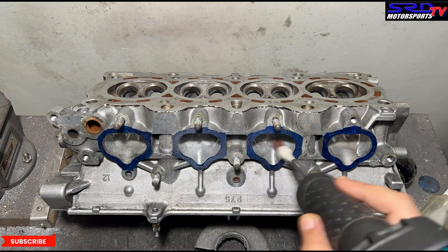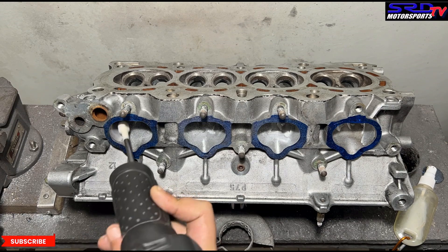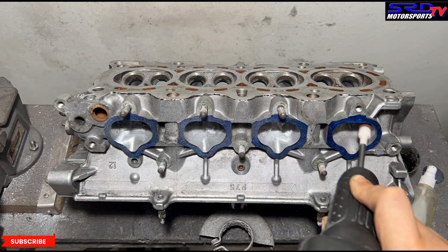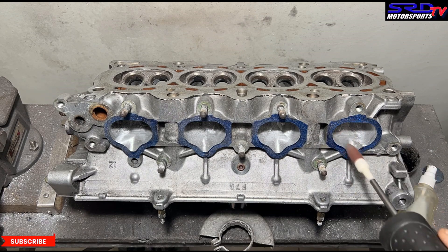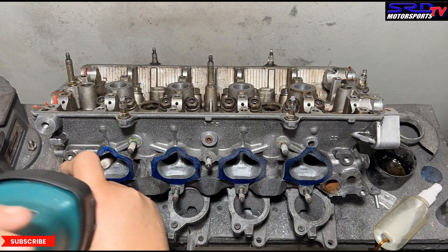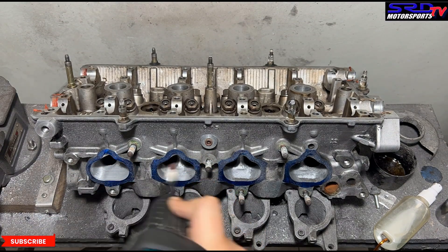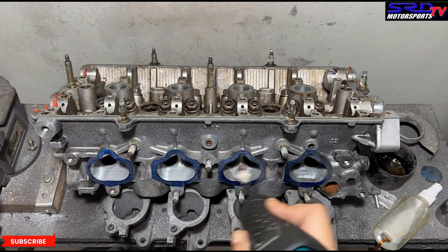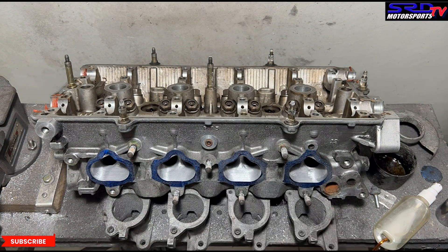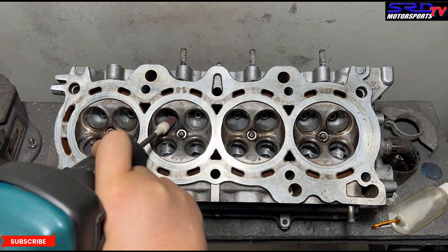This method helps me smooth it out better and more appropriately. As I mentioned at the beginning of the video, when you port the B-series VTEC head and then port a D-series single overhead cam, H22, S2000, or K-series, they all need different kinds of work done. Whatever works on a B-series VTEC definitely will not work on a single overhead cam head or even a K-series. This is why some builders make a great B-series VTEC head but can't pull it off as well on a single overhead cam — or vice versa. They try to apply what works for one platform hoping it works for the other, which is not the case.